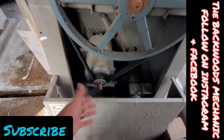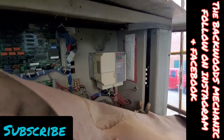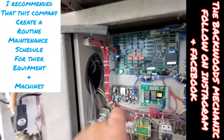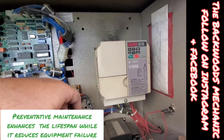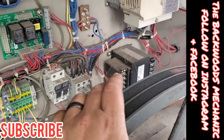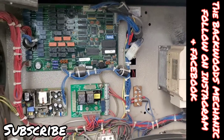We got our lower cover off. You got your motor, your big tub wheel, and this old cardboard here is just destroyed — they might as well move that completely out of the way. Here's where everything is: you got your PCBs, your relays, your contactors, your vibration switch — the whole nine yards that basically runs this entire machine. We got our little wires coming right through there that we're going to be tracking down. You got your computer system here, the V1000, and hallelujah — they left the instructions, so if I need to get into wiring diagrams, I love it when they leave the information in there. I do offer my services to come in, give recommendations, and tell people about preventive maintenance schedules.